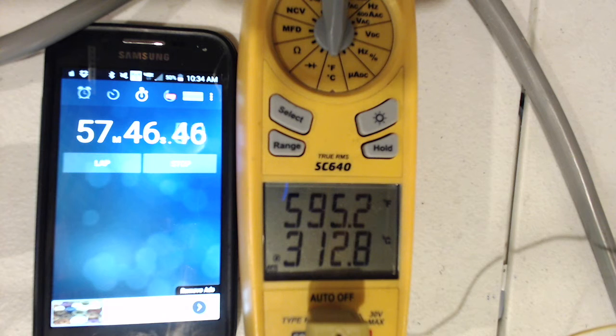I wasn't going to let it keep going — I don't know how long it would take for that magnetron to fail. I did have one where a little kid set the microwave for like 30 minutes, thought it was a timer — probably a six-year-old. It fried the magnetron, and that was a QBP. That's the only time I've ever seen a failed QBP magnetron, so these things are really die-hard. I recommend this brand no matter what microwave you're working on.